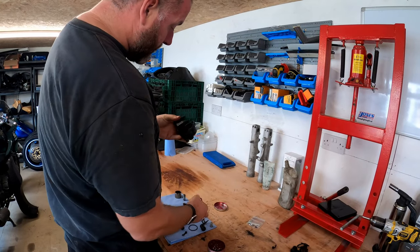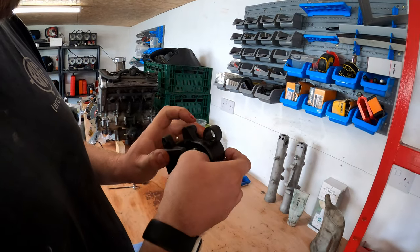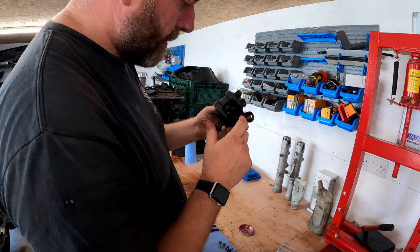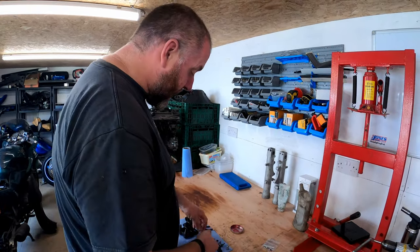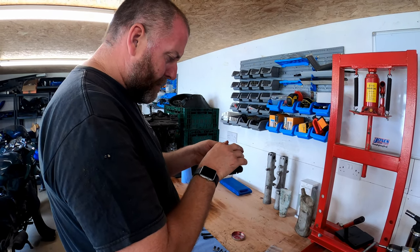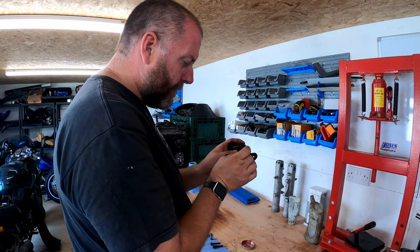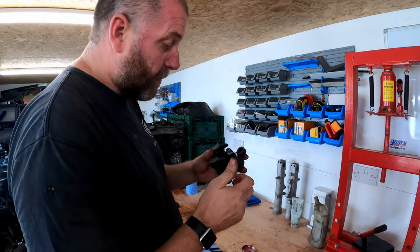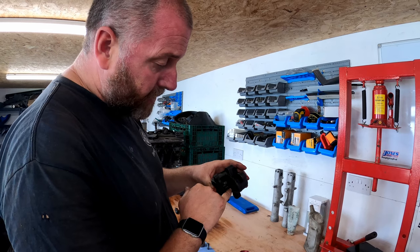I'm going to lube the seals up with plenty of red rubber grease — give it a good coat but don't go absolutely crazy with it. Simply fit the seal into the slot from whence the old one came. Being a bit slimy it'll wiggle around all over the place, but it will go in eventually — and there we are, it's in. Some people like to just lube them up with brake fluid, but I prefer not to because I don't want brake fluid sat behind the seal. It's hygroscopic, and brake fluid sat behind the seal absorbing water will just attract moisture, sit behind the seal, and corrode the casting — these are only aluminium and it'll just go powdery.